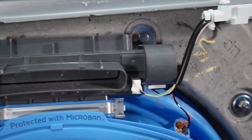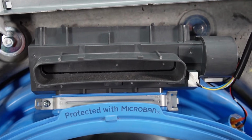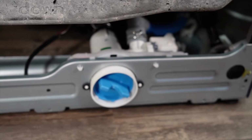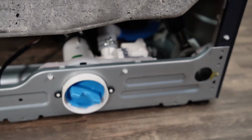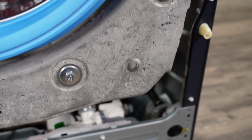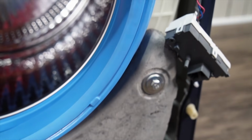It's very rare that these wires will break, but there are some few instances where a wire was grounding out somewhere, causing the board issues. If this was the case, the wire trunk would need either replaced or repaired. Usually the damage would be right around where the wire harness plugs in or where a cable tie is.